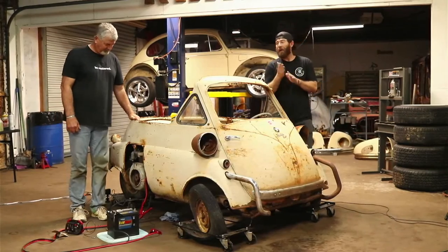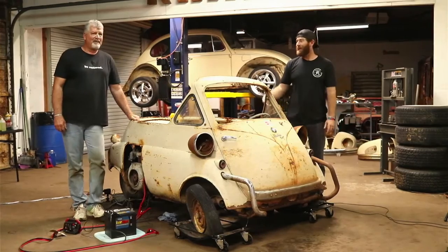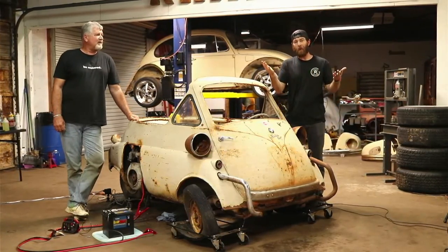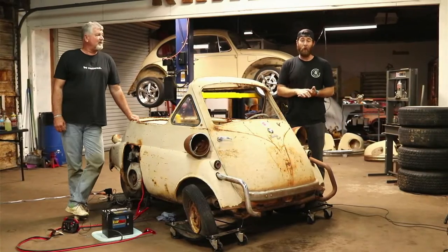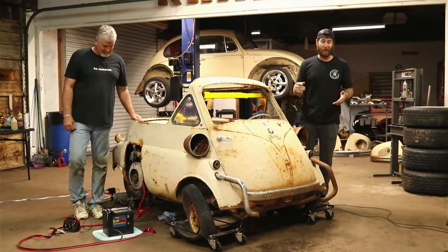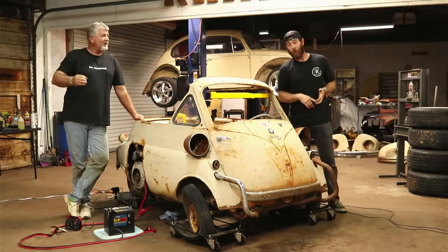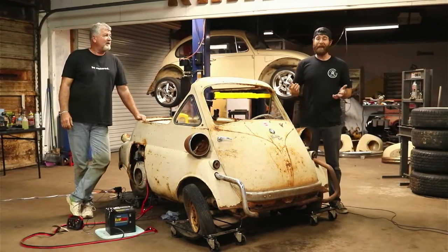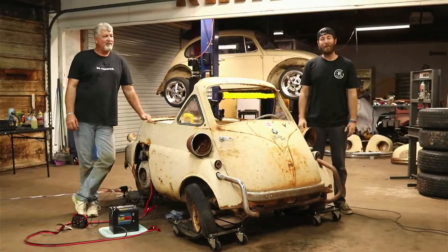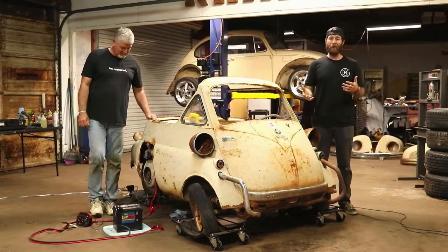Right. And all night I was just trying to figure out what we could do. Dad found some parts, and for about $100 we can get the parts, which is no big thing. We're going to order them, but it's about 3 weeks of downtime waiting on them to get here. So we were going to get a condenser, new points, and go ahead and get a new coil as well. So we got up here this morning and tried to think it out, of what we could possibly do to make a little headway, what was possibly going wrong.